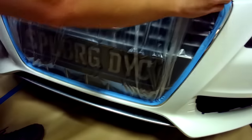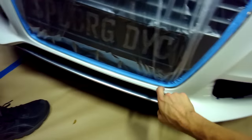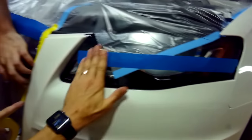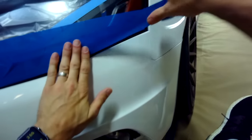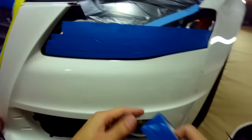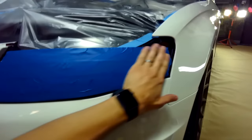Repeat the same thing on the other tail lights and the headlights as well. Gabe's already starting to work on the grill — he's got tape and drape and is lining the outside of the grill all the way around, then bringing it all in. The entire large surface area is protected by one piece of tape and drape. Tape and drape is not included in the pro car kits but it really does help save a lot of time and energy. He's then going to go around the edge very carefully with yellow tape to seal it off.